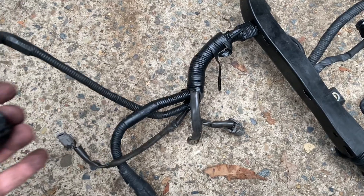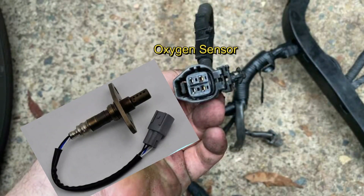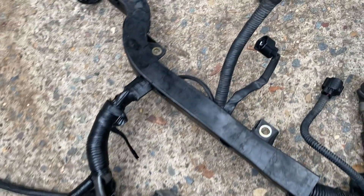The 4-pin connector is the O2 sensor connection. This is a heated sensor as it is located near the catalytic converter. The heater circuit is controlled by the ECU by providing an earth to the sensor.